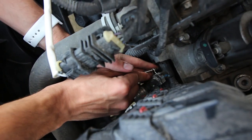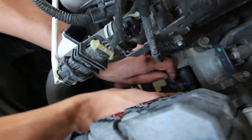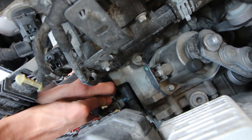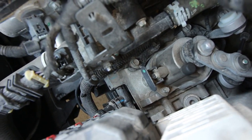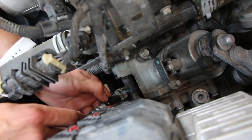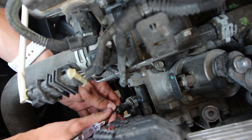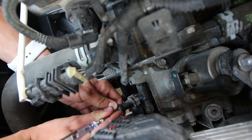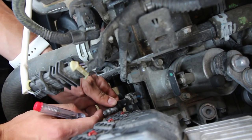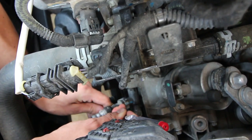I have to take the whole thing off. So you take this clip off right here, this little clip that's holding it on, and then there's a clip on the back here. You're just going to rotate it around. You see this little aluminum piece showing — get your peg under it. I use a peg, but you can use a flathead screwdriver as well. Start from the other end; there are points on each end so you can just get in there and push it out.